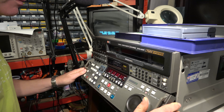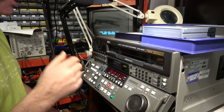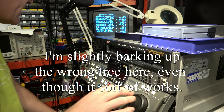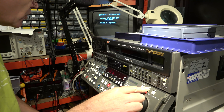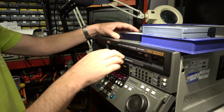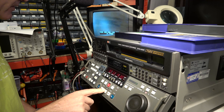I figured I must have screwed up something in the menu. Going into the menu down to local enable, it says S, T, E, J — which means stop and eject only when it's in local. Well, that's not very clever. So if I go to all enable and press set, that means it will do everything. And now all functions are available — you can tell because I can press a button and it lights up.